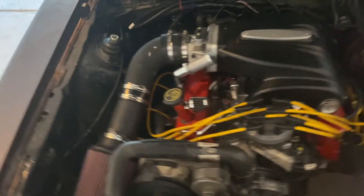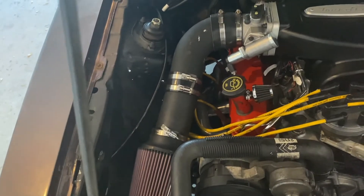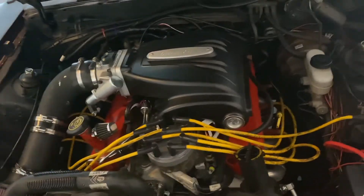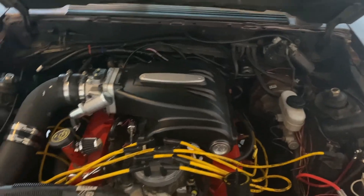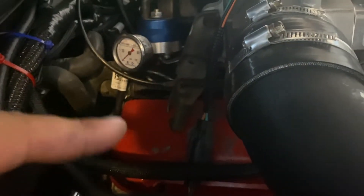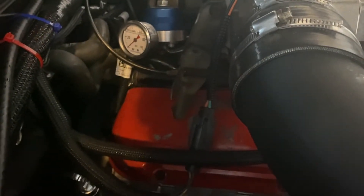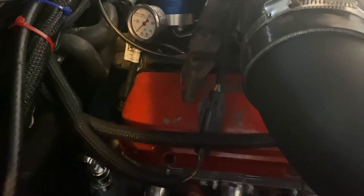All right, got everything put back together. What I ended up doing is moving the intake tube a little further in, so now it fits much nicer inside the engine bay — doesn't hit that strut tower at all. Looking good. Got everything buttoned back up, gonna fire the engine up. Number one — make sure the engine runs fine, and number two — that this knocking noise, or more of a valve train noise coming from right here, was actually just that number four cylinder intake rocker arm being a little bit loose. I believe that was really just it. We'll see if that was the issue in a second.